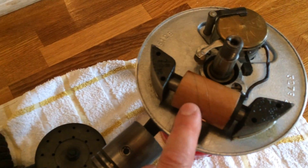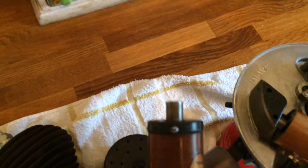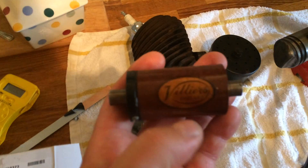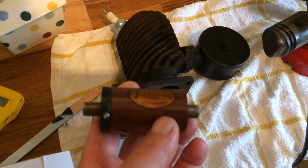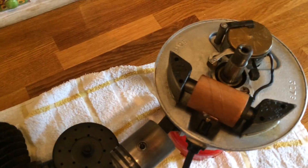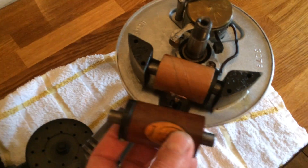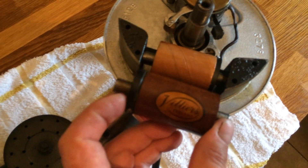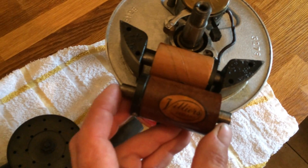Before, the genuine Villiers coil would cost about 60 pounds plus VAT, which kind of renders the restoration not really worth doing. Now there is a problem with sizes — as you can see, that one is far far longer, the core sticks out, and the little round locators which clamp into the ears are far longer.